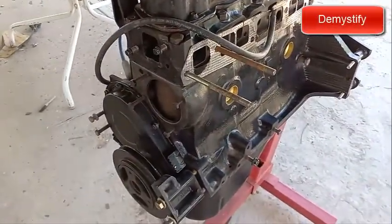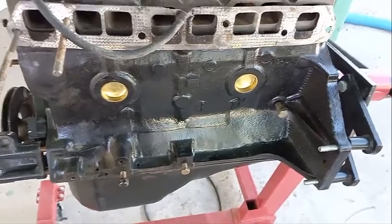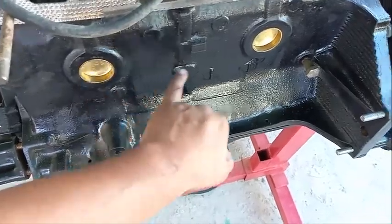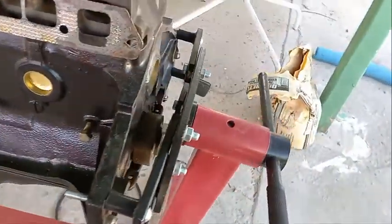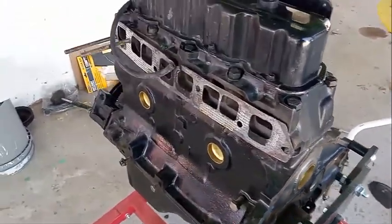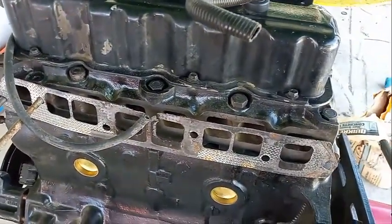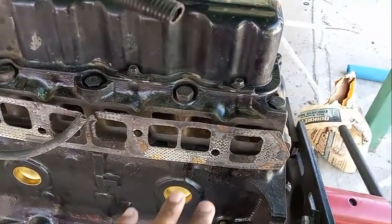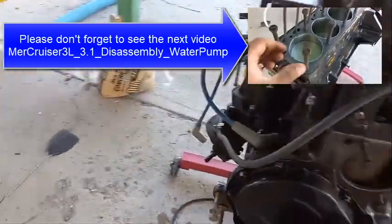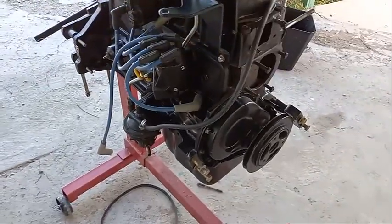The freeze plugs just make sure — if they start leaking water, that's a common thing — so when doing the overhaul, put some gasket sealant on them, or ask the machine shop to put them on; most of the time they're good about it. I'll be creating another video showing those holes and tunnels from the bottom to the top so people can better understand. That's the water system overview — thanks and bye.